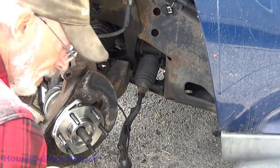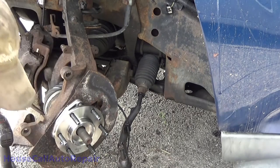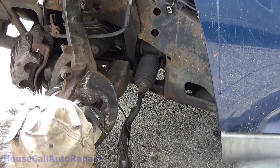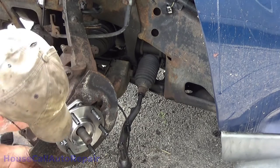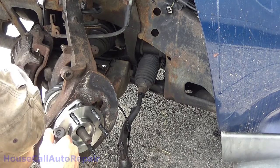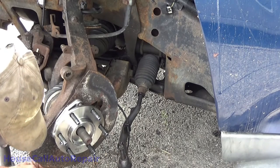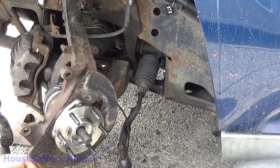Now, let's see where our little hole for our cotter pin is. Right here in the front, and it's already lined up. We'll get the cotter pin in alongside facing down on this one. Feed it right in. Gently persuade it the rest of the way. Grab the long one, pull the long one down, and fold it right around the stub. That way nobody gets caught on that.